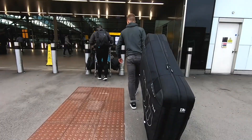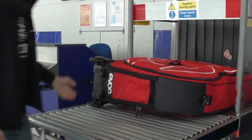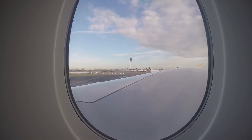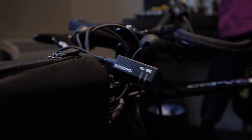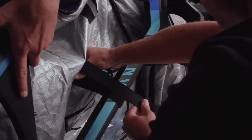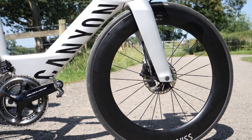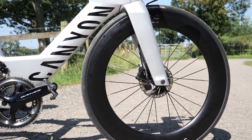If you're flying, a bit more time and care goes into packing before you hand over your precious bike to the baggage handlers. Most triathlon bikes are designed with travel in mind, especially the newer ones — triathletes travel because triathlons rarely happen on your doorstep. Your new bike may have come with nifty engineering to make it really easy to pack, like a two-part base bar or even its own travel case. If you didn't get a case you may need to upgrade your bike bag. Disc brakes require through axles, so if your old bike bag uses quick releases like those of Bikend, Thule, or Sicon, it won't work for your new bike. You'll either need new adapters for the through axles or a whole new bike bag.